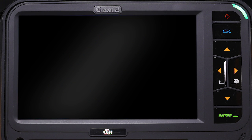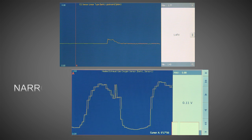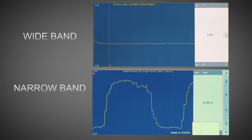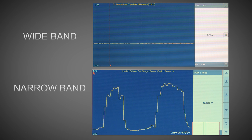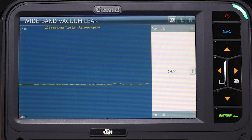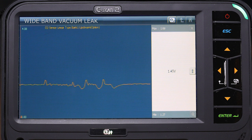To diagnose a wideband oxygen sensor requires a scan tool and if possible one with graphing mode. The voltage on the scan tool is not a real voltage but is calculated for display purposes. The voltage range can vary from vehicle to vehicle. This is a comparison between a narrowband and a wideband sensor pattern. The wideband sensor should not be a fluctuating voltage signal like a narrowband sensor. Just like narrowband sensors, a wideband sensor can be tricked by air leaks and leaking injectors etc., so this needs to be considered when dealing with these sensors.